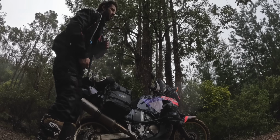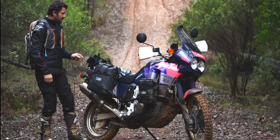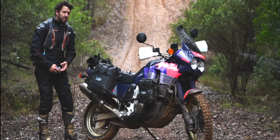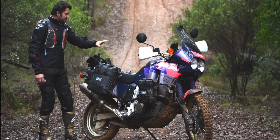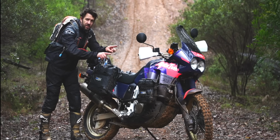This is really important. Never use a top box. Don't go there. Go for the pods before you ever consider it. You don't need a top box, please. Don't go up and back with weight. You want to go down and forward with your weight.